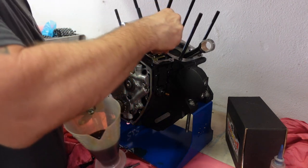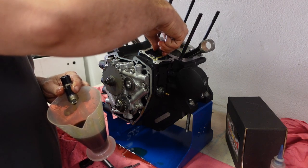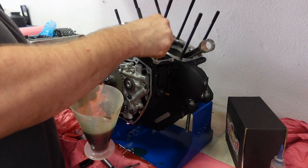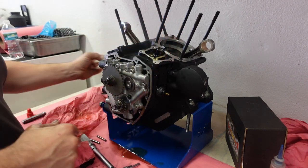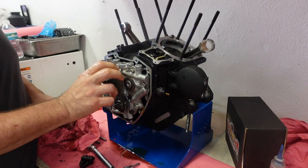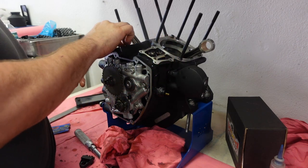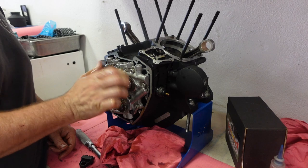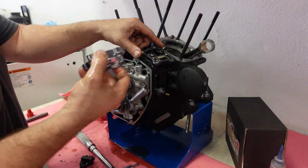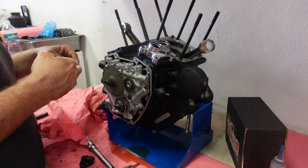Now we install our lifters. They've been soaking in oil so they should be pretty well bled. I had Dark Horse do these lifter bores so everything is really tight and solid — just under one-thousandths clearance. I like to spin the cam and make sure the lifter is moving up and down freely. Then put the anti-rotation pins on, and again spin to make sure nothing is going to bind. Install the gasket and the lifter blocks — the bolts get blue Loctite and are torqued to 120 inch-pounds.